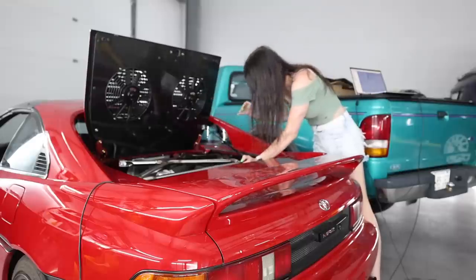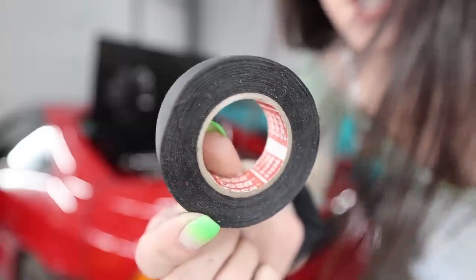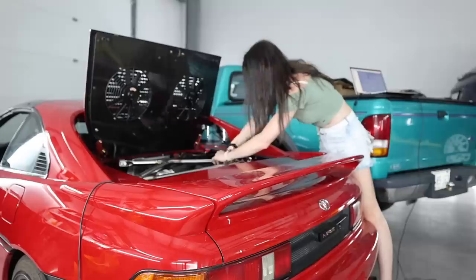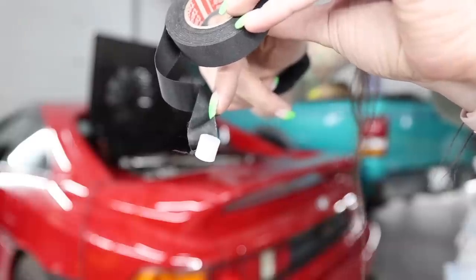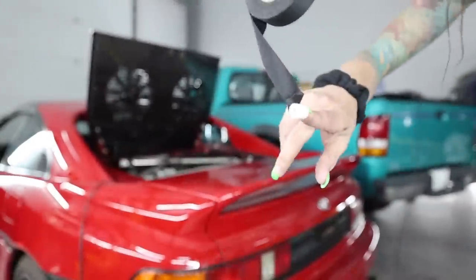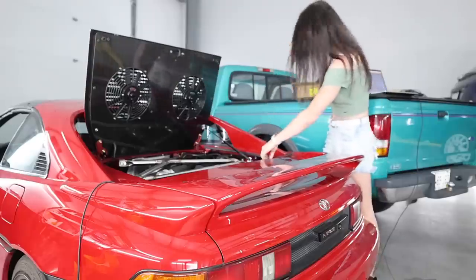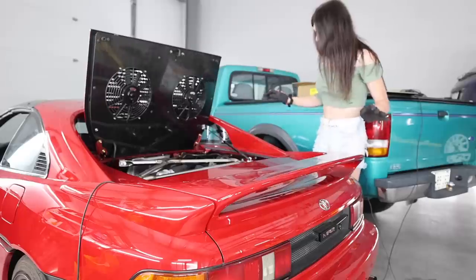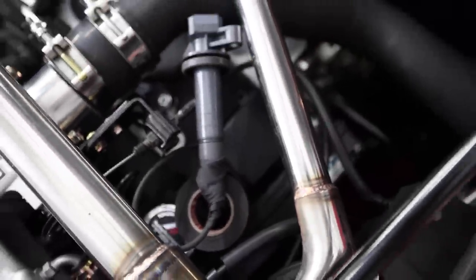I don't want to drop my little spacer down inside the engine that's underneath the coil pack, so I'm gonna use some tape to stick it to the spacer so I can pull it out easier. Ow, that's f***ing hot. Just like that — that's how you don't lose a spacer. Magic. And I didn't even waste any tape so I can just roll that back up. Everything is so hot in there. It's a tad sketchy but it'll get the job done.